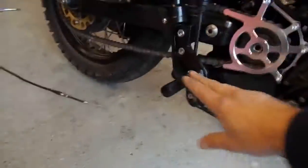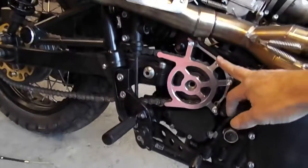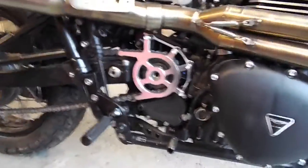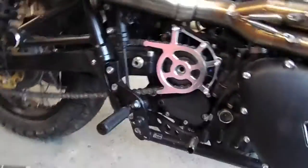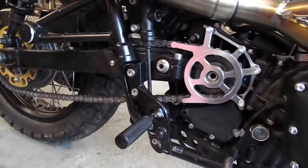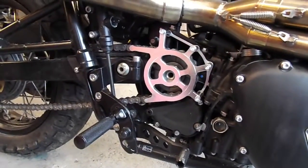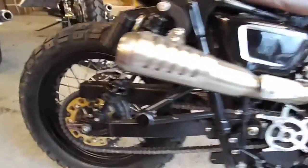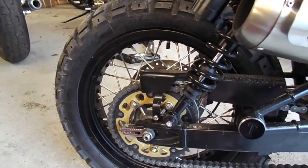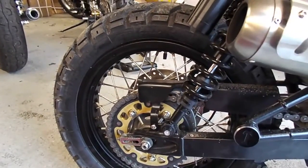On the other side, we've put the lightweight foot rest on the sprocket cover and a lightweight drilled gear lever. This makes all this area of the bike look a lot neater and slimmer compared to the clumpy standard foot pegs and brake lever. We've also put a dual metal rear sprocket on — it's alloy in the centre with a steel outer for hard wearing.